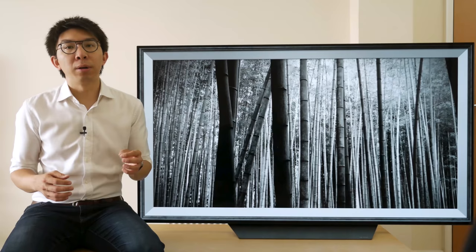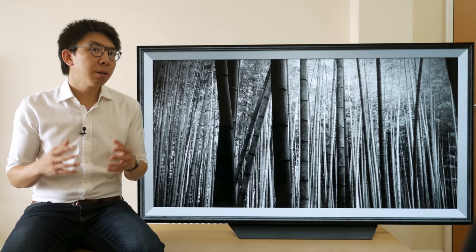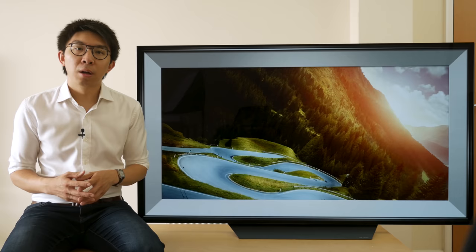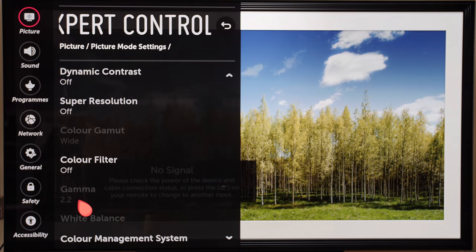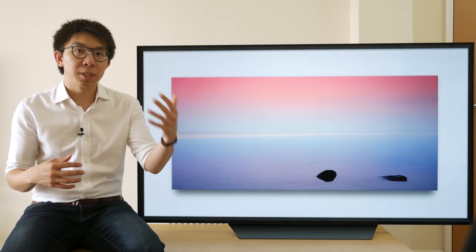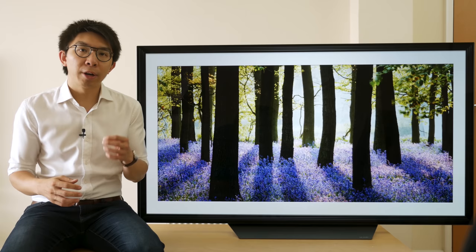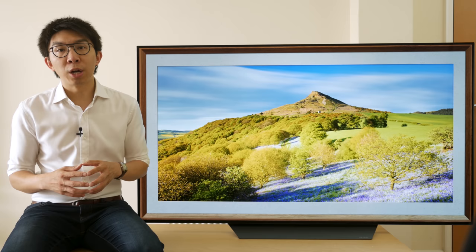A quick word about the 3D LUT AutoCal feature. I was extremely excited about its potential at CES earlier this year, but after in-depth testing, I'm still hesitant about using it when calibrating for my customers for a couple of reasons. First, after 3D LUT auto-calibration on 2018 LG OLEDs including the B8, some important picture settings such as colour gamut, gamma and white balance are locked, and there is currently no way to save these settings so that customers can restore the calibrated settings themselves in the unlikely event of a factory reset. Second, although LG Electronics and Portrait Displays have worked hard to improve things, tonal gradation is still worse after 3D LUT AutoCal. Some other calibrators claim that Lightning LUT, which measures only 101 colour points and interpolates the rest, can be used safely without introducing issues, but I'm still not 100% happy with the results at the time I filmed this video in August 2018.